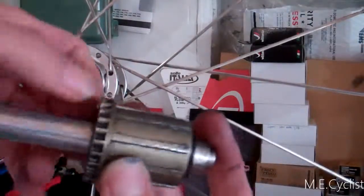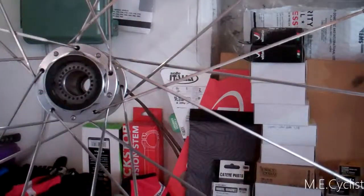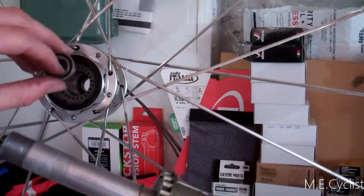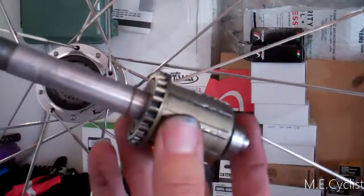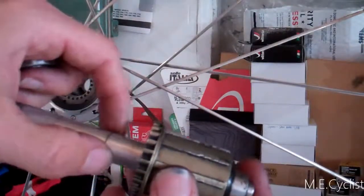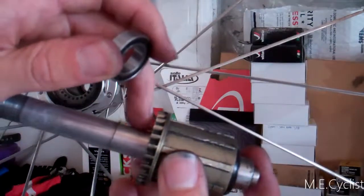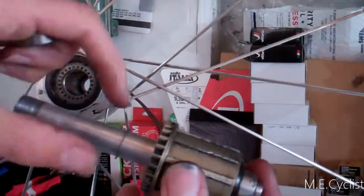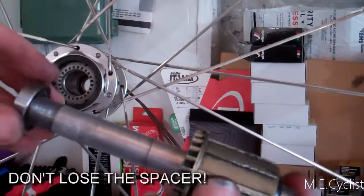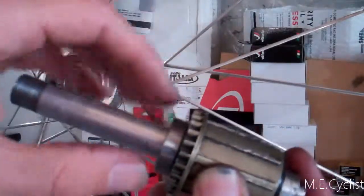One really important thing to know is this tiny little spacer. If you have two bearings sitting right next to each other — like these do, one that goes in the hub sitting right up next to the other bearing — the spacer is in the load path between the inner races. If it wasn't there, the bearings would scrape against each other. So it provides a little gap so they can spin freely and not rub on one another.